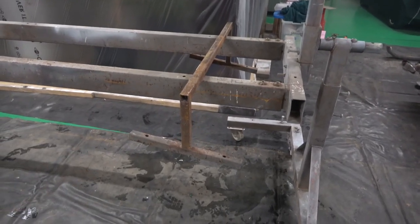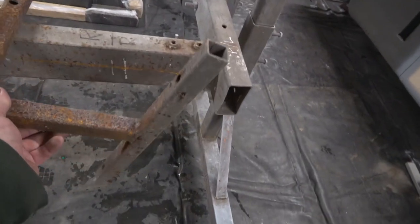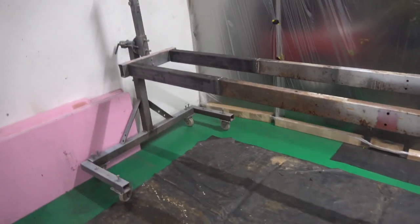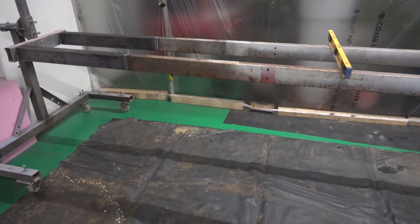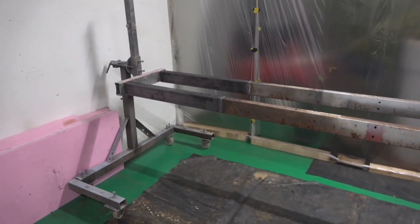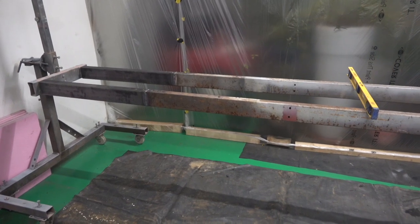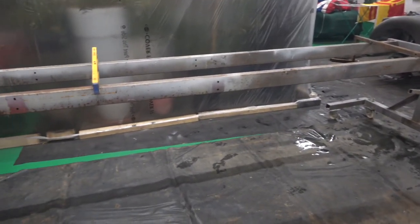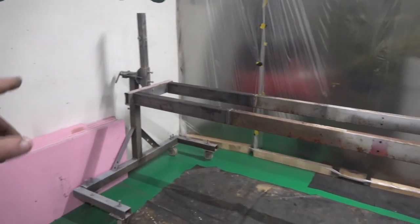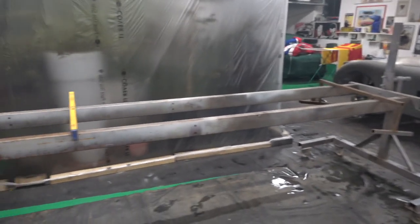There it is — the complete jig. This bar we made up for my XK because there were some problems with the bottom of it. The reason I'm making new ones is that we had bars that were actually stainless steel and the proper length, but they're on the other XK 150 in Czechia being used for painting on their rotisserie. So the E-Types will still fit on this, and you can use it for anything — if you've got a unibody car you can just take these bars off and attach it from the front bumper mount on either side. We've done the same thing with a Mini using this same jig.